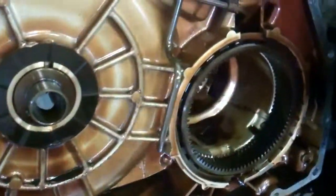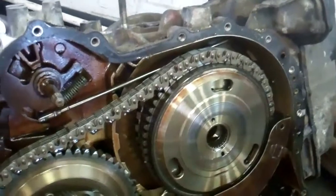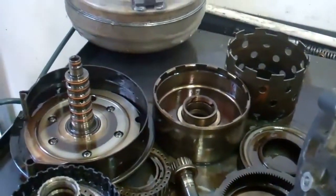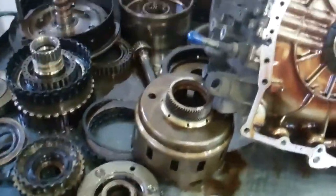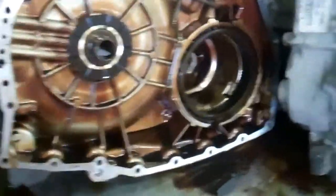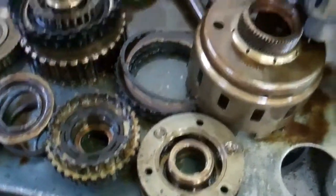So I don't know if this unit is even buildable, Clint. We'll take a look at it and put together a parts list, but this unit is pretty much done. We'll look at some options for you and even get you back on the road with a five year, 50,000 mile warranty. And with this fluid being contaminated, we need to flush out the cooling system portion of your transmission — I'll put a video in there and show you what that is so we don't have this problem again.